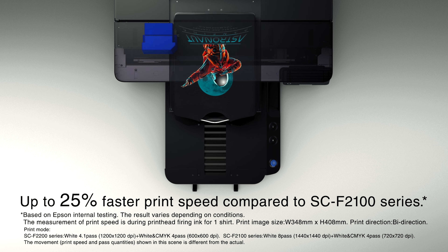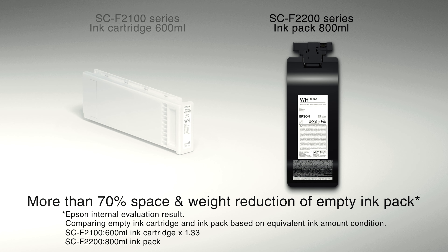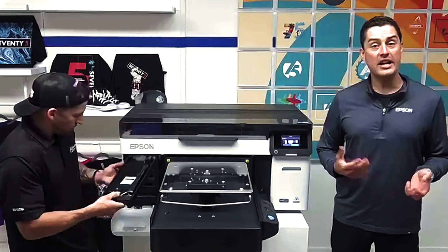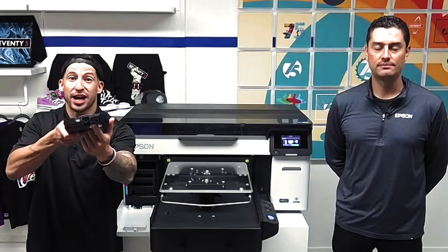This printhead was formulated with the new updated ink system in mind. It's not just the cartridges that are updated — you're going to have a larger ink delivery package: 800 milliliter pouches. We like to look at these as a kind of hybrid, the best of both worlds combining bulk ink and cartridge. With bulk ink systems you get more ink capacity per color, but many machines require you to physically pour in the different colors, opening lid tops and again exposing to fibers, dust, and debris. With the pouch system, you get the benefit of more ink per color, but with the hybrid functionality of cartridge-style microchip and filtration. These chips communicate with your printer to let you know how much ink you have remaining, and they're really solid about getting every last drop out of these pouches.